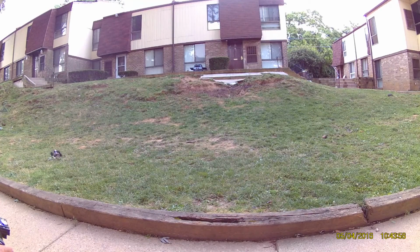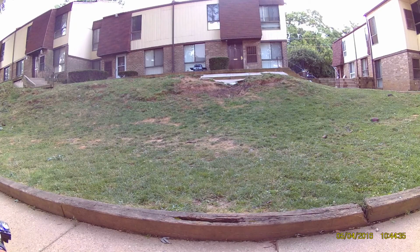It reminds you of this brushed motor, but I'm afraid to add more power because the control arms started bending because, you know, after some jumps, it comes down on one wheel and puts it back, or I run into a wall or one of these railroad ties. We took it to a ball field, set up some ramps, and it was jumping pretty well, and it started to spread the wheels out because the lower control arms were bending. I did replace them with some new ones, and they seem a little stronger, and plus they're red and match everything else on the truck. But I'm still not running it at full power, and it can handle itself.